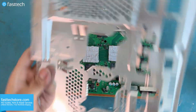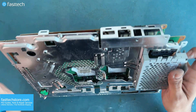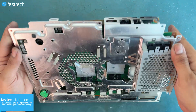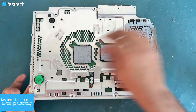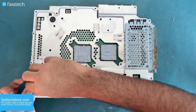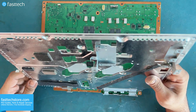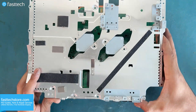Now we are going to install this front plate on the motherboard — the side with the ports goes on first, like a mask, as shown here. And then the back can be pivoted on like this. Let's connect the clock battery connector on the motherboard. The back plate has these teeth that go in these slots on the front plate like this.